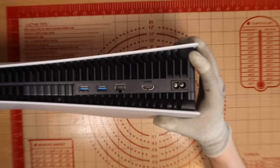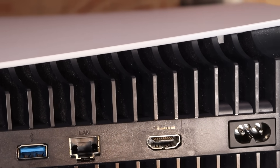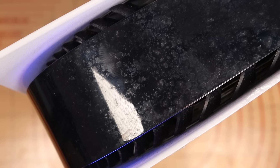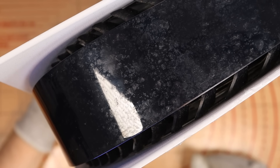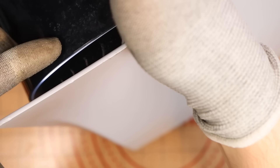Can I see anything obvious with this one? Yes I can — wow. We might actually go two for two today on the PS5s. This one just has what looks like a dodgy HDMI port. Let's see if it actually gets power. If we get power and it goes to white light with no display, it should just be a nice simple HDMI swap. We do get power — it powers on. You can see we have the blue light. There we go — we have a white light, so it does boot to something. This one hasn't been opened and it's actually one of the newer board revisions.